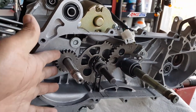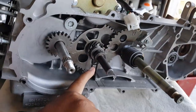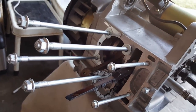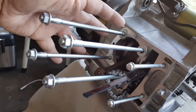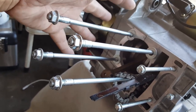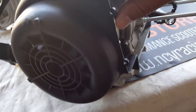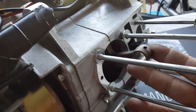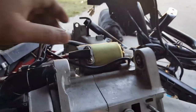This video we're going to show you how to kick off the kickstarter gear, and we'll probably need the tool to get in, so we'll have to take out all the kickstarter mechanism as well. If you remember our previous video, we showed you how to take out the cylinder head and cylinder unit, so we won't cover that again here. We're going to show you how to take off the stator cover, the flywheel cover, the fan, the timing cover, and the left-hand crankcase in order to take out the crankshaft itself.